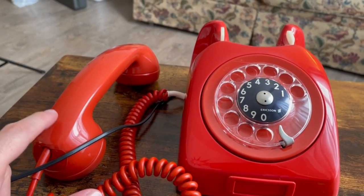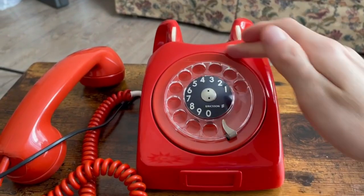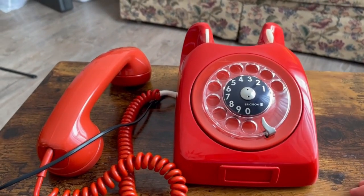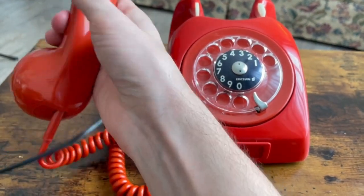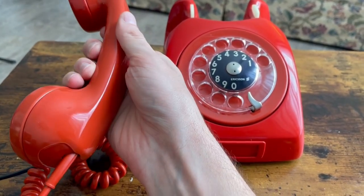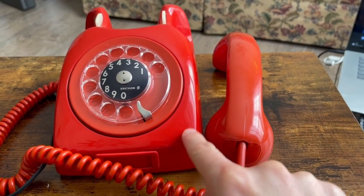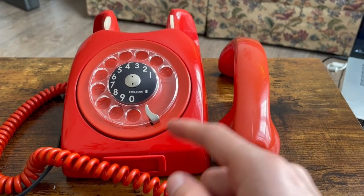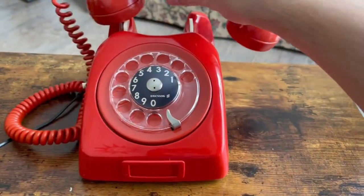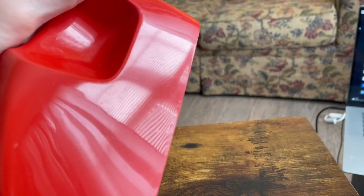After applying several layers and doing several go-arounds with the heavy scratch remover, I used the light scratch remover as a finishing touch. I only used the light scratch remover on the handset and the bezel, and used both heavy and light scratch remover on the main plastic shell. The telephone looks really good despite some discoloration from the sun — it's a bit faded. You can tell the difference in the colors of the plastics, but removing the clear layer didn't change the color of the shell. And you don't have that ugly rough bubbly-looking surface anymore.